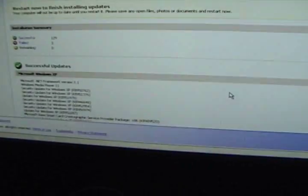Well, actually, I added the system registry to it right after I booted into safe mode, because I had to disable the onboard graphics. Whenever I tried to boot the system, it would show a black screen. I knew that the operating system was loaded, but unfortunately, I didn't have the VGA cable hooked up to the onboard video, which is silicon integrated systems. And that's what the chipset is on this type of motherboard.